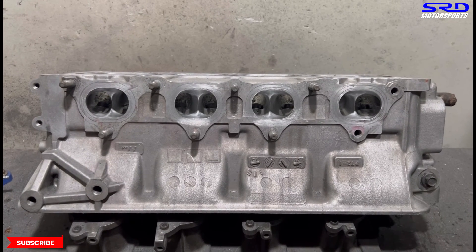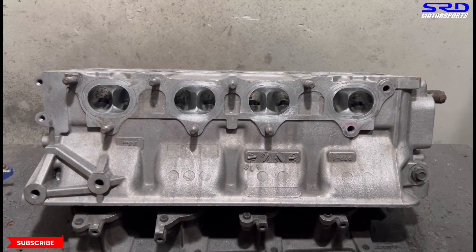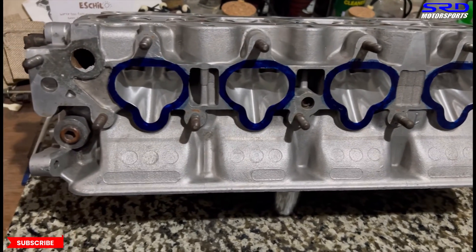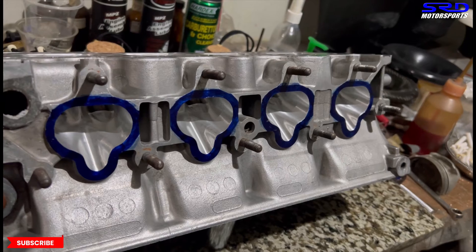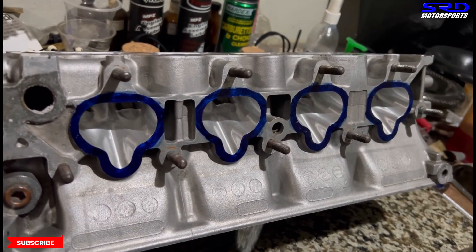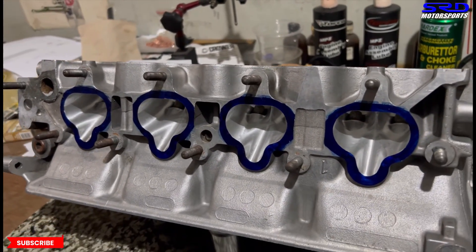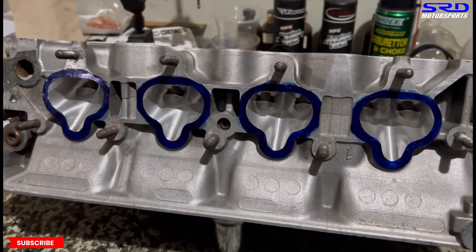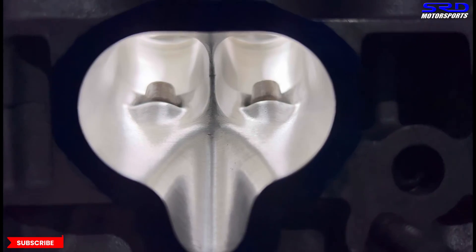On the intake you can see how it varies from the throat, through the port, into the bowl. Then we clean up the head and bring it to the workbench. We inked up the flange with die layout ink so it looks cleaner. Look at that port finish — it's right on the money. The glare of the light shows the shape is consistent on all four ports.